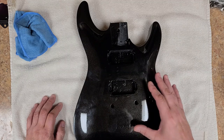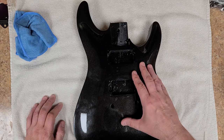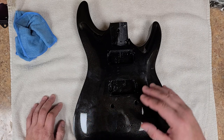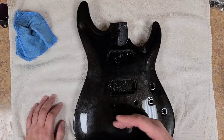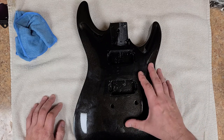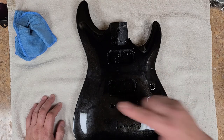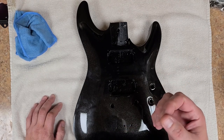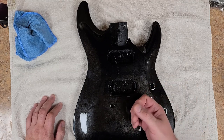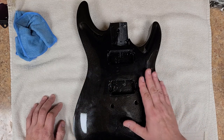So what I've got to do next with it is basically wet sand the body and get it ready for the next steps. Now the reason why I put a clear coat on this was to protect the black diamond paint that is underneath the clear coat. So if I end up doing my striping or however I'm going to do the artwork on here and I go ahead and apply the next coats of paint, that paint will have something to bite into — as far as the scratches that are in the clear coat. Not only that, if there's any type of problem with the masking tape and some paint might have gotten underneath it, it's easy to fix without having a problem going through to the black diamond that's underneath the clear.